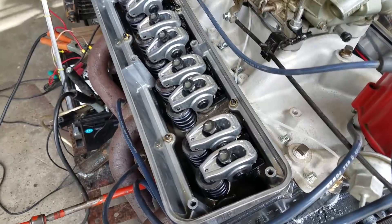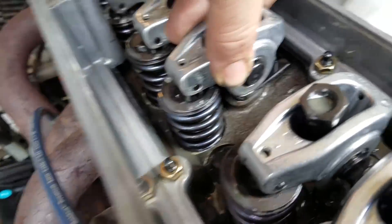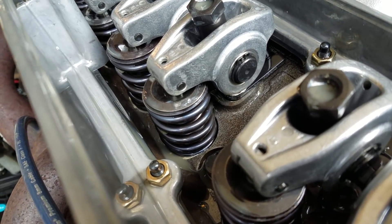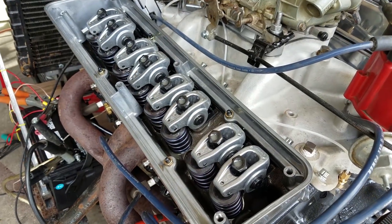So we ended up shutting it down and pulling the valve cover and we were looking at the rockers — we just figured one of them came a little loose or whatever. We found the one that was way looser than the others and got to looking at it. We thought it had stuck a valve because the valve was down a little bit below the rocker, like it wasn't actually touching the rocker, so the spring was slightly compressed. He didn't actually have the heads rebuilt — he lapped the valves and stuff — but a valve getting stuck in the guide, maybe got a little warm, that just happens sometimes.